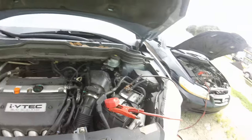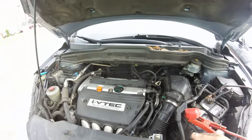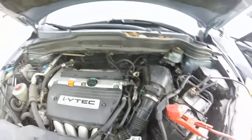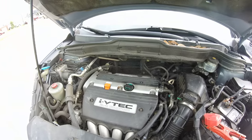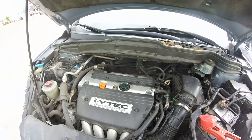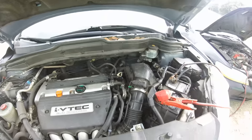One of the other checks I would do if this had first happened and some water did get in the intake: take the four spark plugs out, pull the coils out, and then just spin the motor over to blow any water out of the cylinders. Then put the spark plugs back in and attempt to crank it.